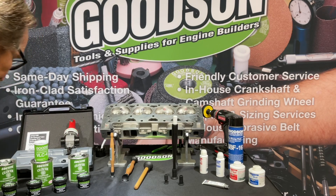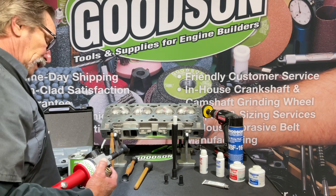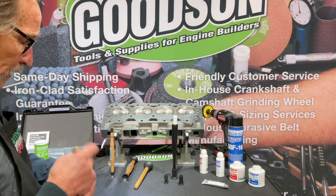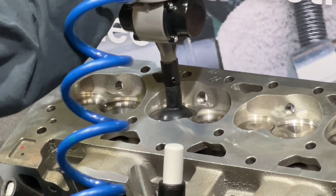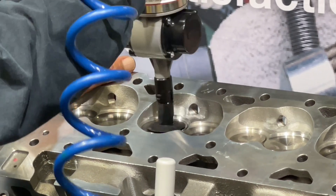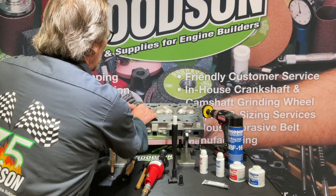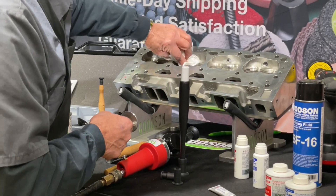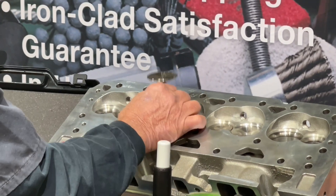The one I like most is the AVLP300 — this air lapper right here. It comes with a variety of suction cups, all held on by a socket head set screw, and includes wrenches, extensions, and additional vacuum cups. Just take your shop air, plug it in, and you can see that oscillating action. Put it up on the valve and you can efficiently and effectively lap the valve onto that valve seat. Wipe it down and you can see exactly where the valve seat and valve have made contact — you're good to go.